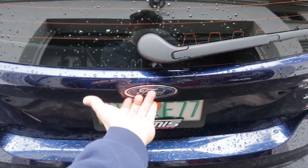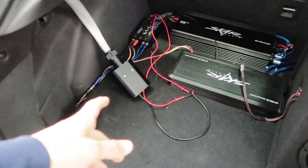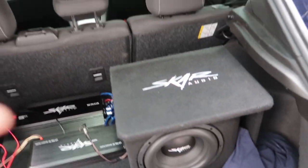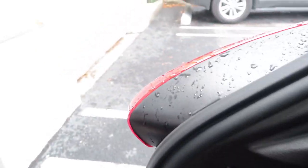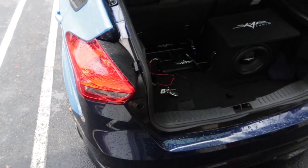Open the car, lift the trunk, and voila. You can see how I keep everything in the back. Taillights are really easy to remove — all you have to do is remove this little plastic cover right here, and then there are two twisting knobs you just twist out. That's literally it — no bolts, you can do this with your hands. You could even do this at a public shop if you want.